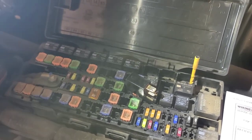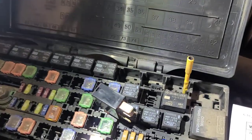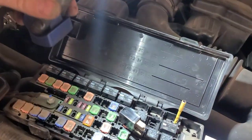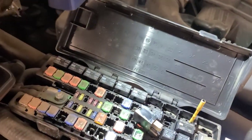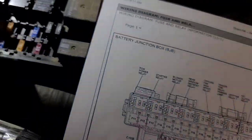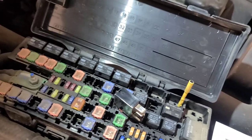I did an interesting thing just now — it scared me. I was checking pin fit and was having trouble seeing the terminal, so I grabbed this cordless trouble light and set it on top of something near the relay box. I just happened to set it on top of this relay and the starter motor cranked over, because the magnet on this trouble light turned on the starter relay, which is the second one. That's interesting.